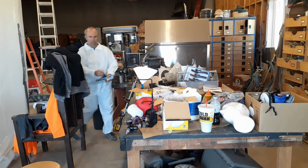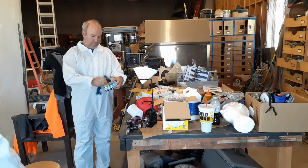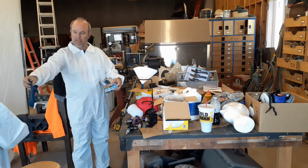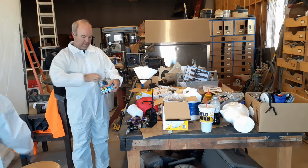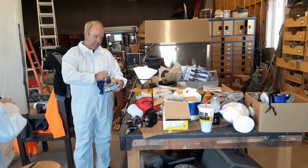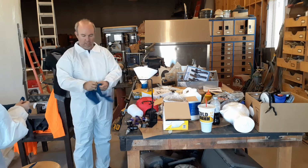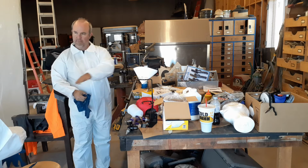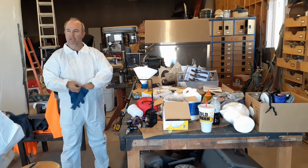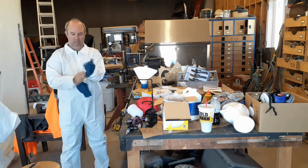Okay. Since it'll be hard to hear once we get in there, when we're laying out the paint, I'll paint the first piece, the first quarter panel, and I'll let you do the other. And decide if you want to keep going or have me do more of it. But you want to keep it nice, even, and your movements nice and slow, even strokes, overlapping just a little bit, but you don't want it to pull up, because then you get bumps in your paint.